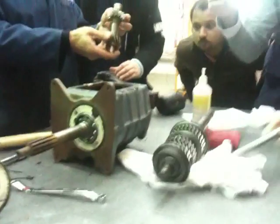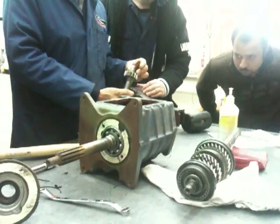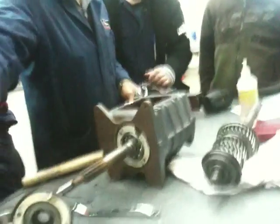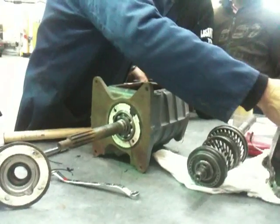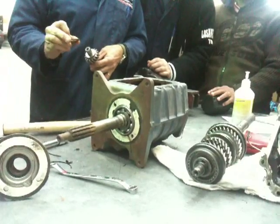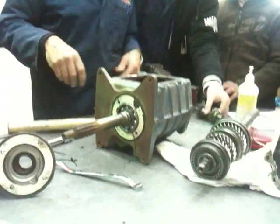All right. Here's our reverse - two reverse gears. There's our straight cut gear. It's got a thrust washer on the end of it there. See on the inside here it's got a notch. That notch is to stop this thrust washer spinning round. What's happened is that the tag has started to disappear - that's not good. That would mean this thing would spin, and because it's a bronze face it absorbs oil and lubricates. But with the tag worn down, it would spin inside the housing and eventually chew the housing out - which is rather expensive.